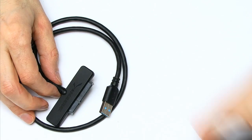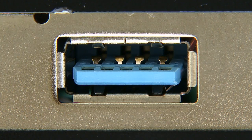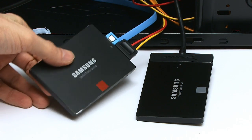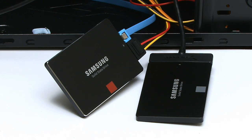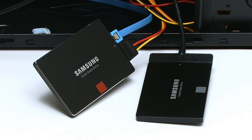I'm going to take this SATA drive — a new Samsung Evo drive — and connect it to the adapter. I'll then connect that in turn to the USB 3.1, USB 3.0, and USB 2.0 connectors on my test rig, and transfer three gigabytes of large files to this SSD — a Samsung 850 Pro connected directly by SATA to the motherboard. Even copying SSD to SSD will not saturate the theoretical 10 gigabits per second speed of USB 3.1, but it's the fastest test I can think of.